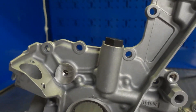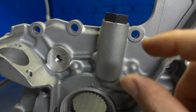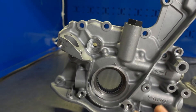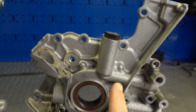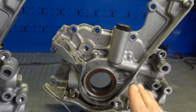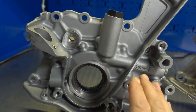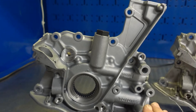Obviously the sticker could fall off over time, so it's going to be hard to tell if this pump is modified, but you can definitely tell by the screws that it's been opened. The other thing they speak about in the description is that they have modified the oil relief valve. That's not something you can see, so that's something you have to trust after purchasing the pump. What that basically does is they shim the relief valve, which makes the tension a little harder, allowing the oil pump to create a little bit more oil pressure. Generally, the stock pumps run about 80 to 120 psi. With this modification the psi goes up by about 10 psi — so if the pump is running at 100 psi, this one's going to run 110 psi. A little bit more oil pressure is good, but not too much — too much oil pressure could actually kill your engine just as not enough oil pressure could.